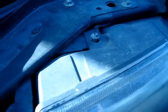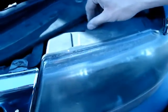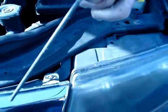The first thing you need to do is use a 7mm socket with a ratchet and just unscrew the screw — it's just one screw. Pull it out. Look how long that screw is. Pull it out.